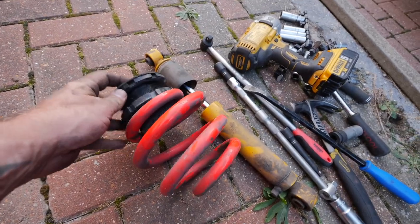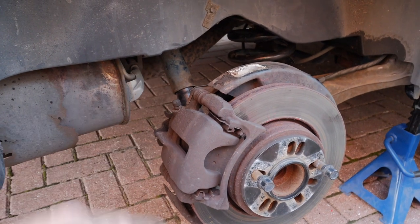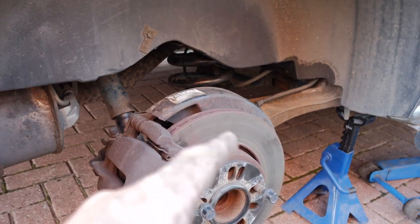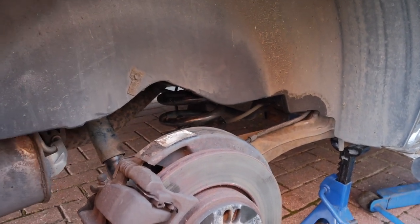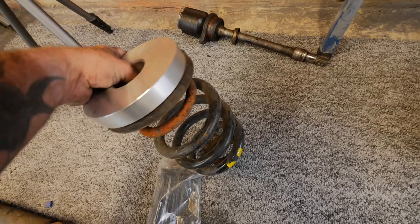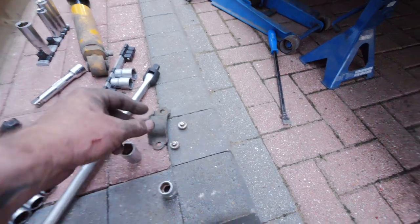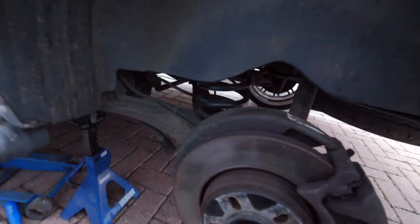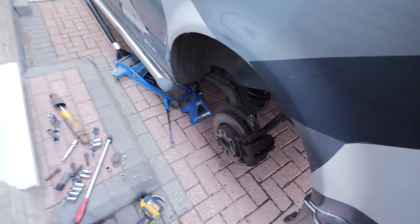The V-Max is out. On this damper the bottom nut and bolt was 22mm and the top was 18mm. You undo the anti-roll bar on both sides and the leg drops down so you can get the spring and spacer in. The spacer goes chamfer-side up. Second side is done. One thing to note: three of the four anti-roll bar bolts sheared off, so I've got to drill those out, tap them, and fit new bolts — that's a job for another day. Just be aware if you're doing this, the anti-roll bar might not come off as easily as you think.